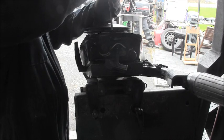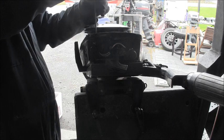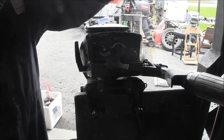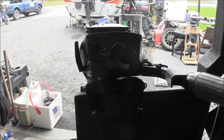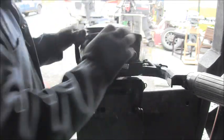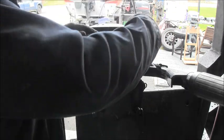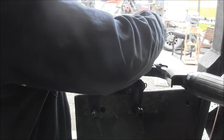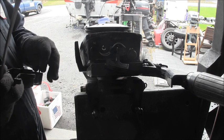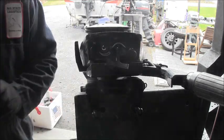All right, first we've got to take off the air silencer. Remove those four bolt screws on the top, then take out the two screws down in the bottom of the air silencer, pry out the adjustment knob, then tilt the whole thing back and pull it out once you get the screws out far enough. You've got two screws and two washers inside that thing.